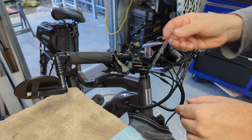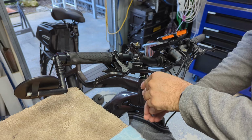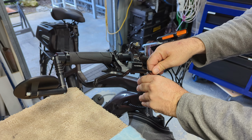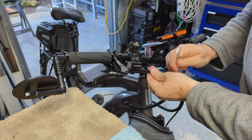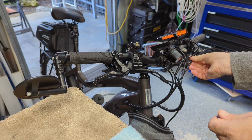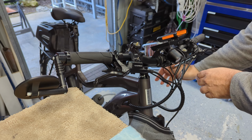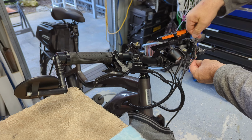So I didn't lose one drip of oil. There's nothing on the rag, nothing dripped out. There's a little bit on the hose, but nothing serious. Okay, that's nipped up. Put the cover back on. Yeah, so I always take them as far as I can with my fingers, and also make sure that it's not just half a turn or something. Make sure you can at least get 3 or 4 turns out of it with your fingers, and then you'll know it's not crossed.